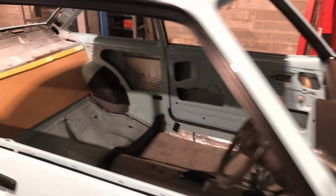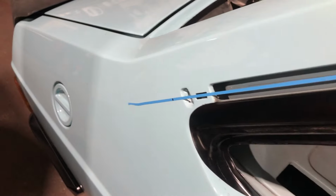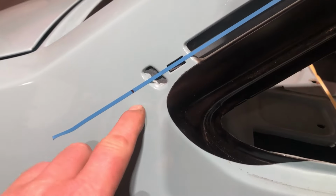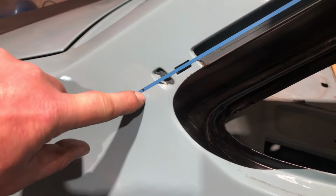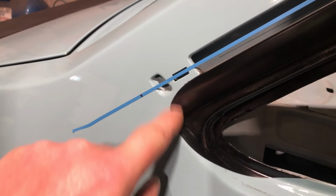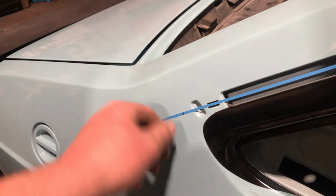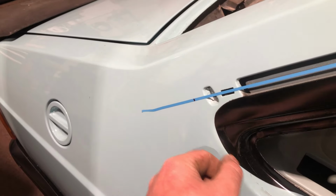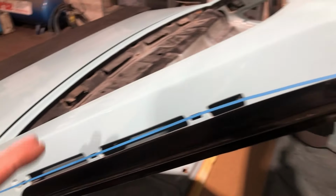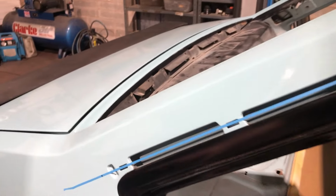And the third reason the glass has to come out is because although it's painted around the windows satin black and generally it's right, you know, everything looks good, on the rear pillar here the trim comes down to here, the black C-pillar trim, and as you can see the black stops short. So all I have to do is flat off this edge, scotch all this. I've marked out on the fine line tape where the bottom line needs to come to, so basically it's going to come to there and just swoop in just to finish it off, and then I'll have to mask out the rest of the car and repaint, which is a massive pain having to do all that just for that little piece.